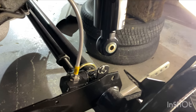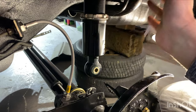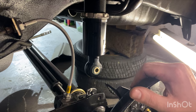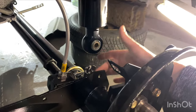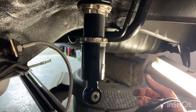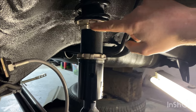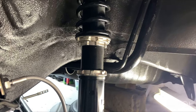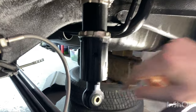I haven't adjusted the height of these shocks — I just took them out of the box and I probably won't adjust them yet. I'll adjust them once I get a set of wheels and have to start playing with the height. But you can see straight out of the box the difference from the factory shock. My understanding is that these two collars up here are set for the preload in the spring. To adjust the height you just slack off this collar and then this whole bottom section threads out — inside that hole is all threaded.